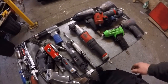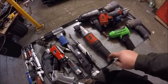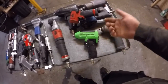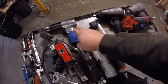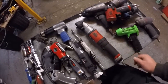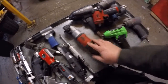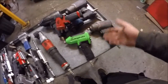This will pull wheel nuts off a car. It has its uses and I'm not going to say its uses are limited because they're not. But when you need this, you need this - which isn't all the time, you may be able to borrow one. I've used it for - you might have seen in one of the videos - Polo drive shafts. You have to have a wobbly socket and all sorts of other things to make it do funny angles, but with this, an extension and a star bit, job done. I think it's 175 foot pound, this is 325, and apparently this is 400.